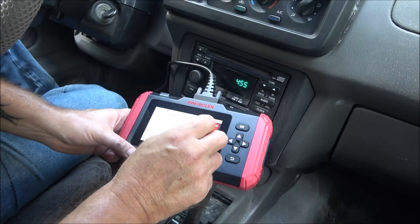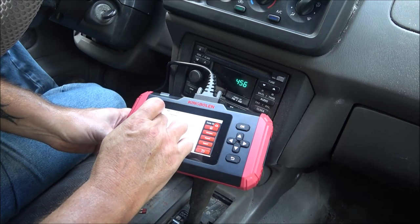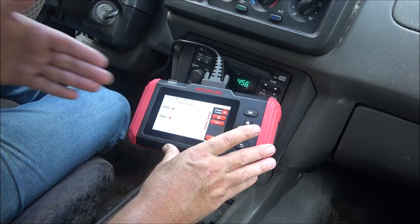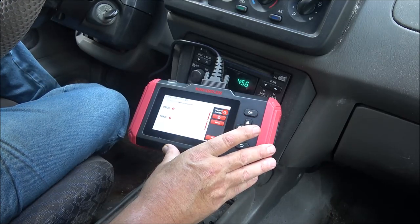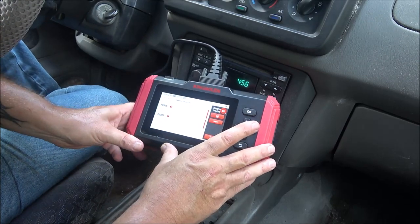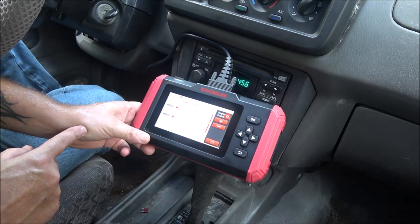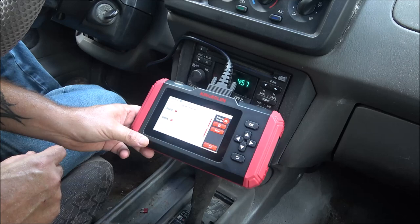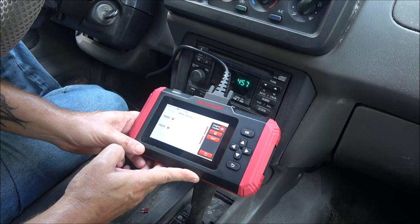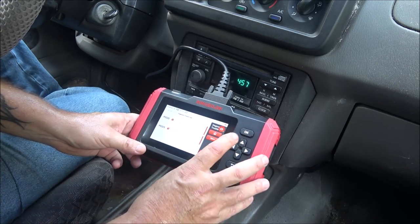All right. Let's go to ECU mode. Still reading. This is ready. Let's go to the misfire. We're going to go to Nissan. We have a knock sensor. I think that's the code we had before, if I remember right. This is the code that we had before on this vehicle, which is a knock sensor, vibration sensor number one circuit bank one, or single sensor.